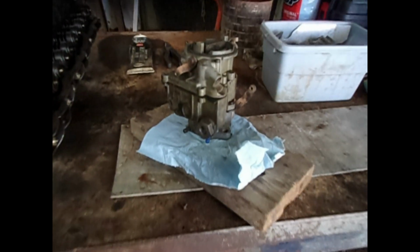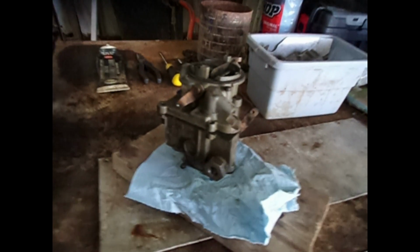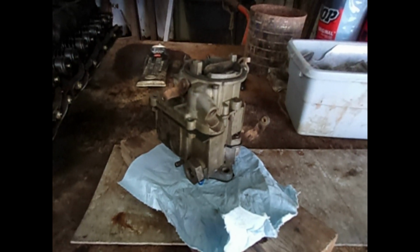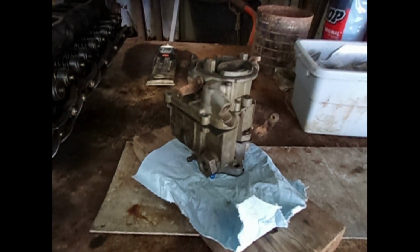Okay, this video will be troubleshooting a Rochester Monojet carburetor. When they were new, the Monojet, Dualjet, and Quadrajets were all great carburetors. 50 years later, they're often worn at the throttle, and that turns into major vacuum leaks, so you have to do bushing kits on them, or else you'll have major vacuum leaks.